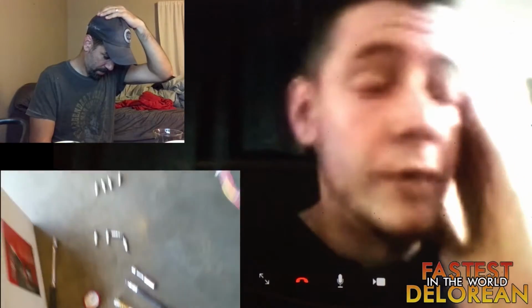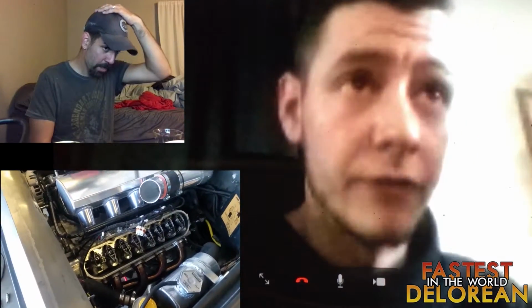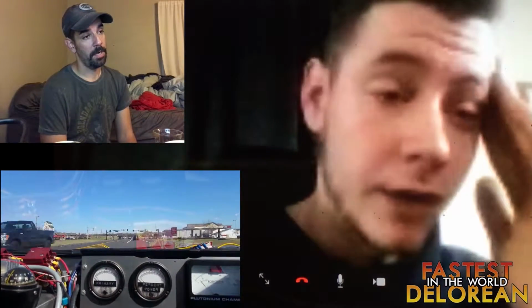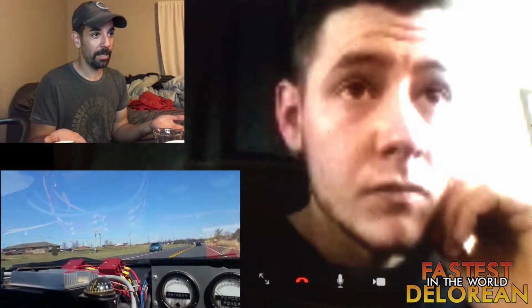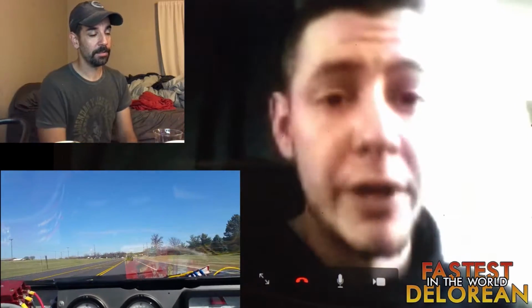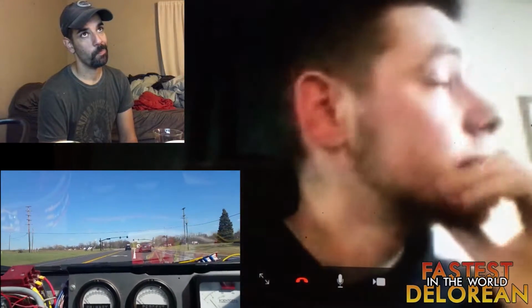Okay. I'm going to have more information on Mike tomorrow. If they don't have guides, maybe a miracle, because he does a lot of high performance LS stuff. If he's got anything in stock, that'll be a miracle. Well, that's the other thing. Can we just temporarily, for a week, put different guides and valves in there? No, those heads are made for those guides and those valves. They're bigger, so if you put normal stuff in it, it won't even begin to do anything. All right.